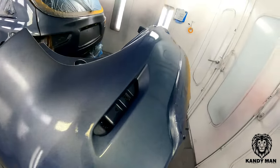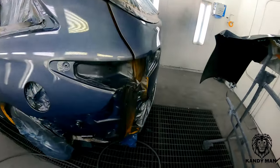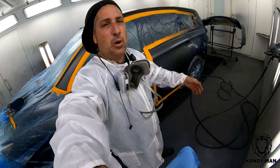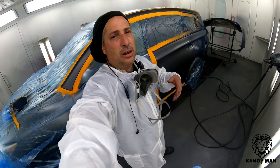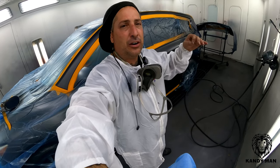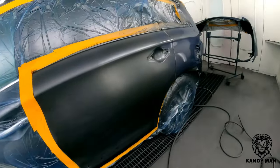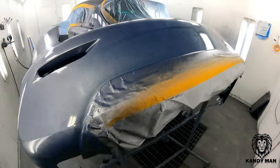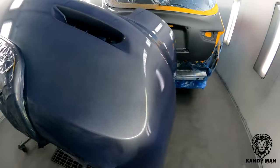We'll be coming back in for the control coat, dropping down to 12 PSI, and then we'll be clearing it. When I'm doing these jobs like this, I've got my color verified, get my sealer close — boom boom — I want to get in and out of here, especially in this type of weather. Once you get in a routine, like I always tell you guys, do things the same way and get better each time — a little bit faster — and keep account of what you do. You'll be able to get in and out of the booth faster. Don't go too fast and rush it and have a bad job.